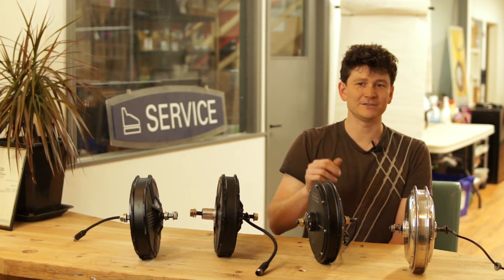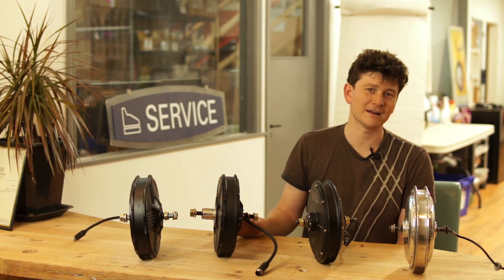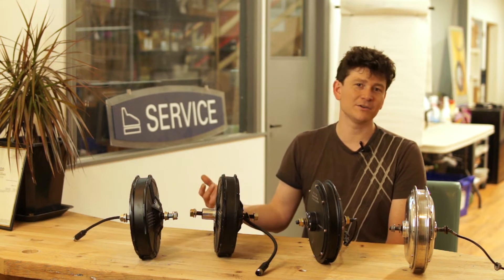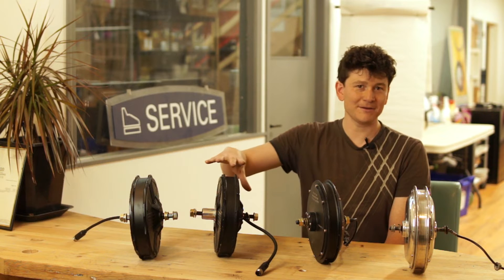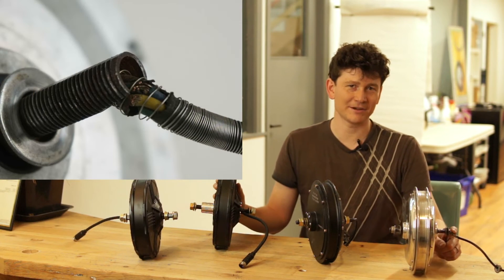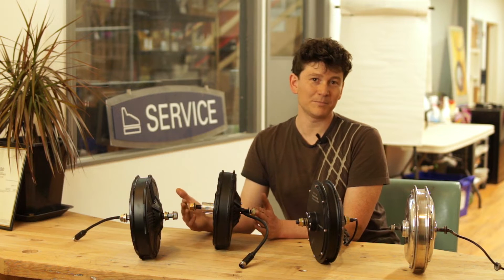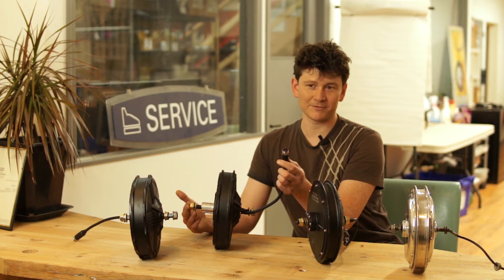The FH and RH212 motors have a 212 millimeter diameter — slightly bigger — and the larger the diameter, the better your efficiency and torque-generating capabilities with a direct drive hub like this. In addition to that benefit, they also managed to get the cable exit coming out of the side of the axle instead of the end, preventing the kind of mashed-up damage we would often see with the earlier end cable. That also allows installation of torque arms and axle hardware on both sides without having to slide any hardware over a large connector.